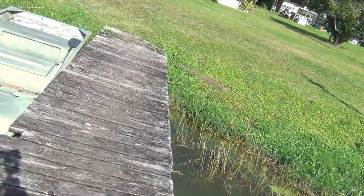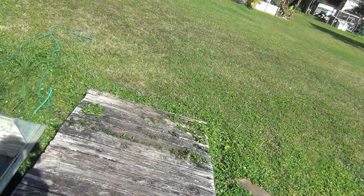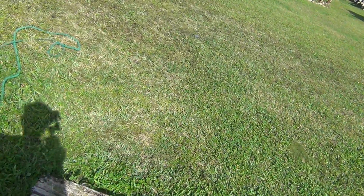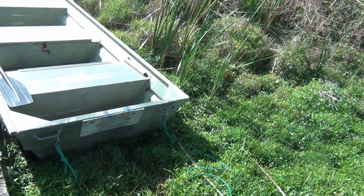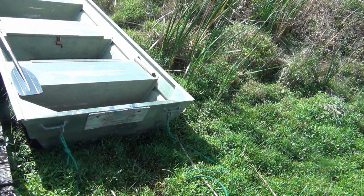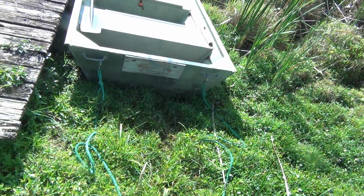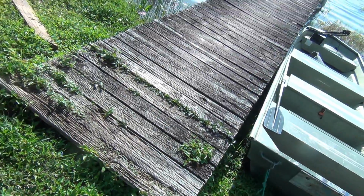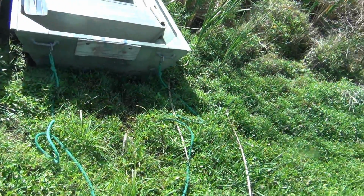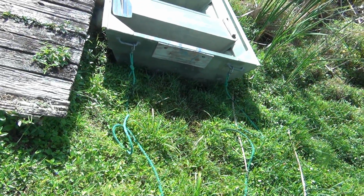When you go to put it in forward, man, it hits right. As soon as you move that lever, it pops into gear. You go put it in reverse, man, you've got to pull the thing way back. So it's in that shift linkage, which I hate screwing around with, and I don't want to do it by the cable because I want to leave everything the way I had it. It was great the way I had it. So let me get this damn thing on here.